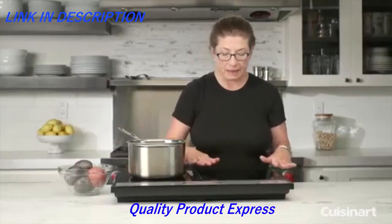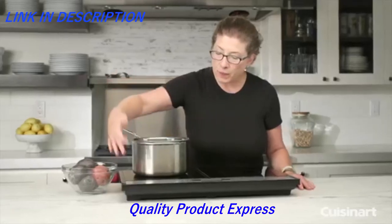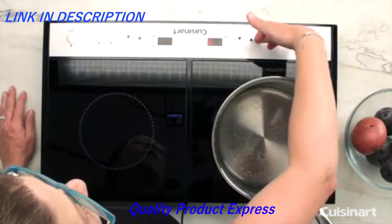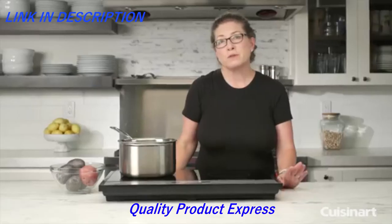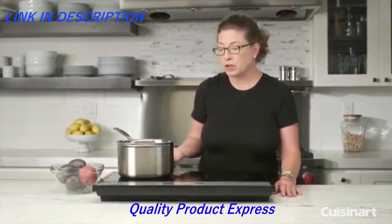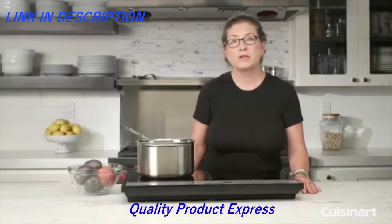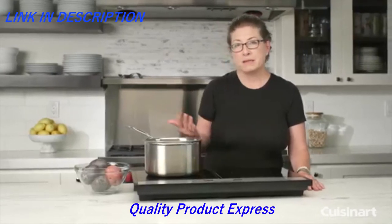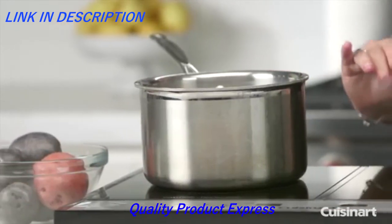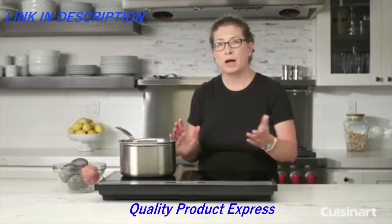You'll notice it's black with a glass cooktop — it's really simple and easy to clean. Also on this side, it's independent, so you have your own timer and your own heat control. Induction cooktops are super efficient and bring water to boil very quickly. You need induction-ready cookware — to test it, just take a typical magnet and place it on the body or the bottom of the cookware. Check the bottom and also check the sides, as some pieces of cookware only have induction-ready bottoms, so they'll take a little longer to come to temperature.